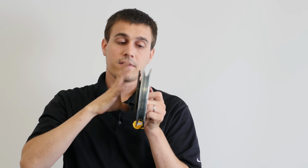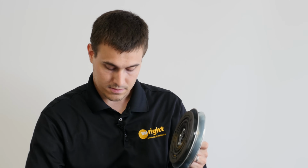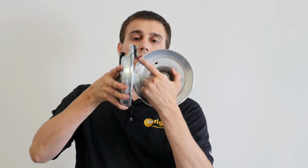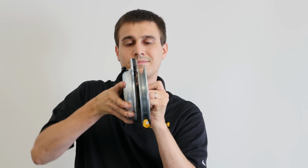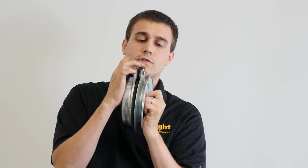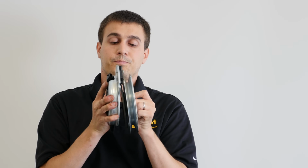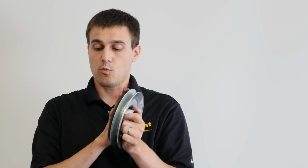When you turn it off, this plate actually retracts, and on the field coil here there's a brake that hooks behind that plate. So when it's disengaged, this clutch here drags against these little magnetic brakes, and that's what slows down the deck. Now when a clutch begins to not work, it's because either that brake or the main plate is beginning to become worn. So this is a Warner clutch, a very common clutch.